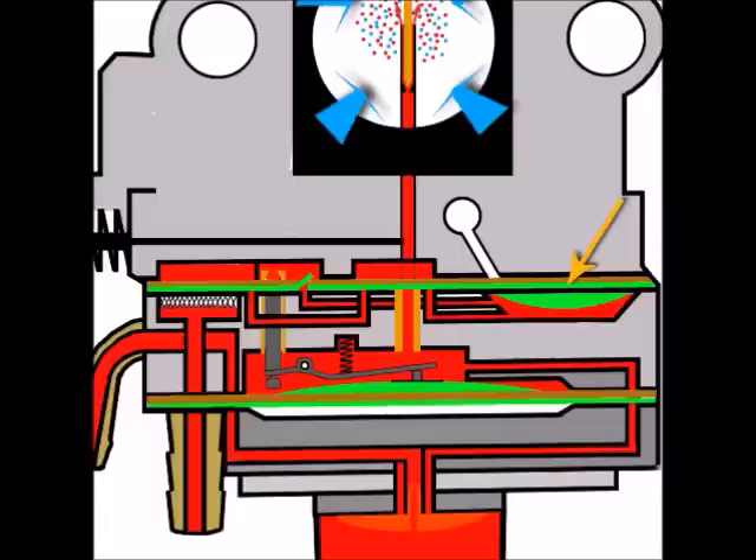Each time the fuel pump diaphragm lowers, it pushes fuel out of the fuel pump reservoir into this fuel vane, then helps push that one-way valve flap off its seat. The fuel then enters the upper chamber and is forced down past the needle valve, which is open due to the vacuum drawing out into the venturi. It's a double whammy: air rushing through the venturi sucking fuel out of the main jet, plus the pump creating pressure in the metering area, allowing fuel to go upward much quicker. The result is the engine running much better and smoother.